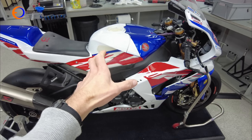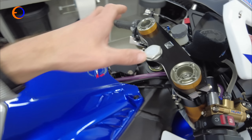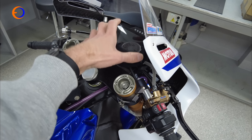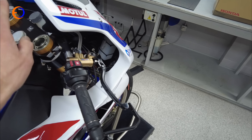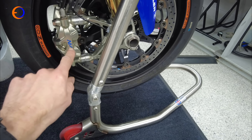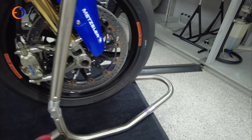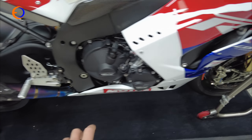While we're here it would be rude not to show off a little bit of Superbike bling. This might look like a stocker, but this is actually Glenn Irwin's TT Superbike from 2022. Compared to the stocker, the top yoke looks the same but I'm assuming it's probably different with different offsets and possibly adjustable. Same dashboard — and this one's on kit ECU, not Motec. He's got proper Superbike spec Ohlins with skeletonized bottoms, and Nissin calipers that just look trick as hell with all the bits machined out of them.